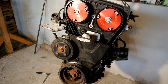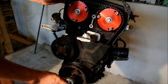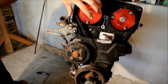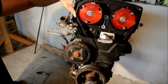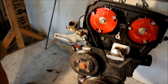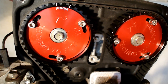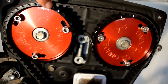What you do then is take your breaker bar with the appropriate socket and rotate the engine. As you'll see, the timing belt will move and the outer ring of the cam gear will also move, but the camshaft — the inner ring — will stay fixed. You can see adjustment one way and adjustment the other way. All I'm doing is rotating the crankshaft, and you can see this cam is just moving normally while you're actually adjusting the other one.